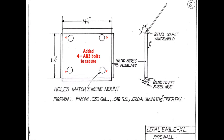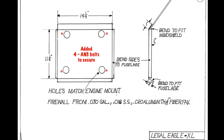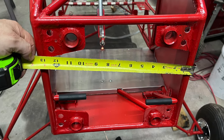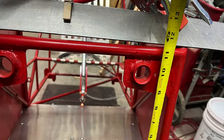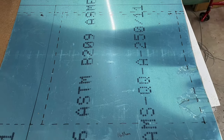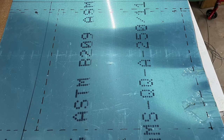Today we'll start at the nose — my firewall. Pretty straightforward. I cut the aluminum sheet and marked all the bends. I used a straight edge to add extra clearance to simulate the windshield. I took it to the brake and made the bends.